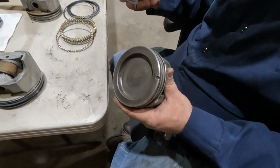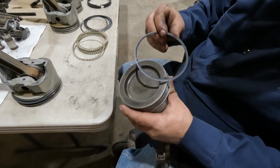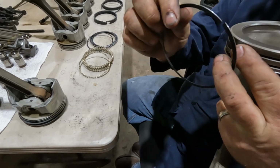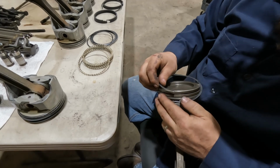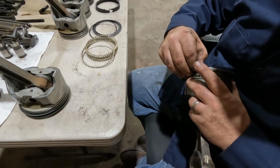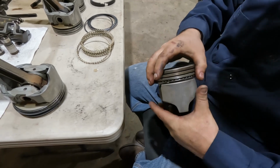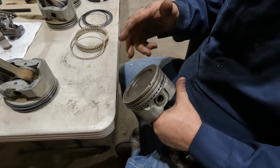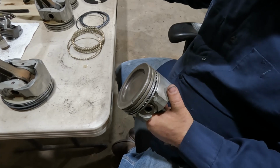As far as piston rings go, there's a lot of school of thought on offsets and all that. Each of them obviously has an opening. It has to be every 90 degrees or whatever is what people say. But I've taken many engines apart, and virtually every one I've taken apart has not been 90 degrees. In fact, several I've had compression rings in line with each other.